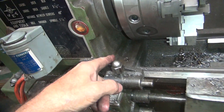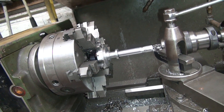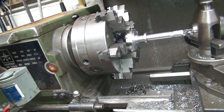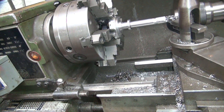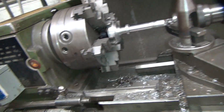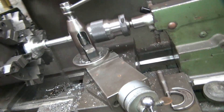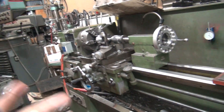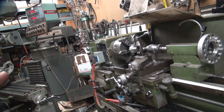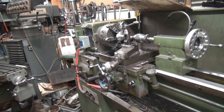So that means tomorrow I'm going to come back and play with this head a little bit, and try to get this squared up. Do a bunch of little slight cuts and try to get this thing where I can cut a straight line without having to fudge it. Disappointing, but it is what it is. Once I get this turned down, I can get on with that one because I've got to be able to make a bushing there. If this lathe is not cutting accurately, I can't do it — we've got to get this lathe to work. One step forward, three steps back it looks like, but I think we're in the right direction. I think the lathe itself is pretty square — I cocked that head and overdid it. I've got to bring it back a little bit and I should be able to dial it in. It's just going to take some fine tuning.